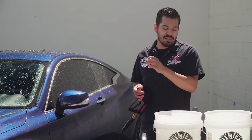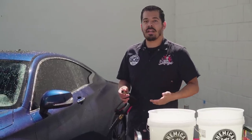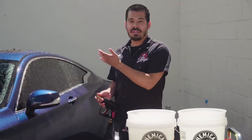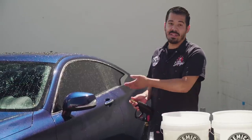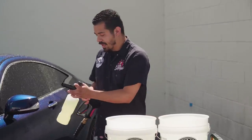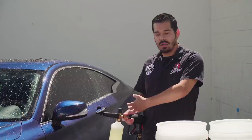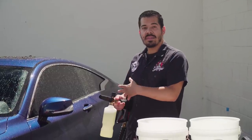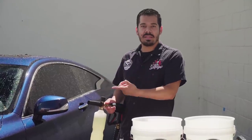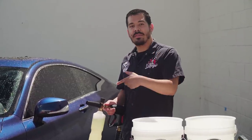All right guys, so we're done rinsing the vehicle — now we're going to begin to foam. Before I start foaming, I want to answer a question I see a lot of you guys ask: can I foam my car, rinse it off, and just dry it? Well, that works out great, but there still may be a fine layer of dirt on your paint, especially if there's no protection, so you still want to go ahead and wipe it down with the wash mitt. I'm going to do two coats. The first coat, I'm going to foam up the car and let that pull off the dirt, grime, contamination, and Clean Slate — give it some time to break down the oils, waxes, sealants, and glazes on the paint. Then we'll rinse it and foam it one more time before our contact wash with our Chenille wash mitt.